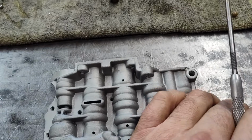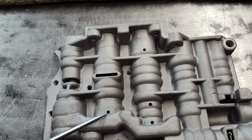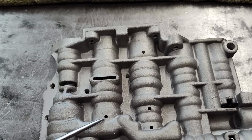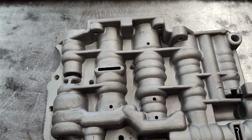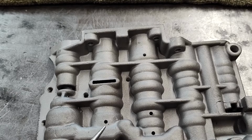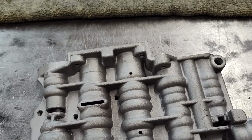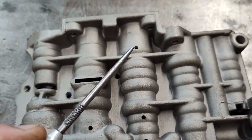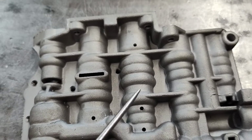Now I ask you to drill some holes, so let's flip this over. You have a hole here, and these hole sizes aren't real critical. I like to use a 93 thousandths drill. I think that's about right. You can go a little smaller, a little bigger. There's really no need to go bigger. You can, depending, maybe you have a kit that doesn't have a lot of sizes, so you can improvise a bit on this. If you make them too big, it bites into the casting and the bores, and it could cause the valves to stick. So one hole here, one hole here, one hole here, and another one up here. The locations, of course, are critical as to which slot you're actually drilling through, but this is what it looks like on the other side.